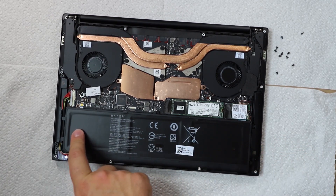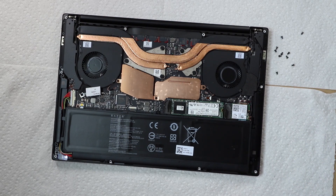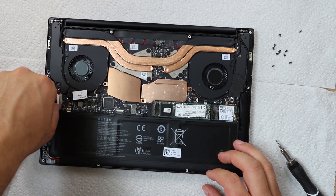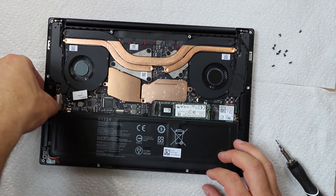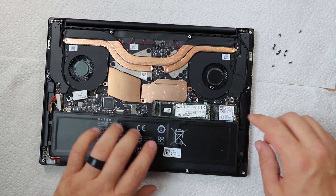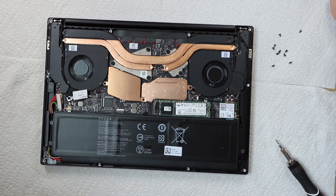All right, so here's the inside of the computer. We have this long battery and of course our SSD, which is right there, which we're going to take out — it's just got the one screw. Once you're inside, touch the metal just to discharge any electrostatic buildup. Then you can pull out your battery — there's a pin connector on this side, on my left — and that guy just kind of pulls right out of there. That's just to make sure there's no electricity running through it. Then you'll see the drive right there.